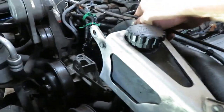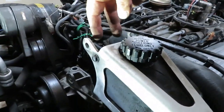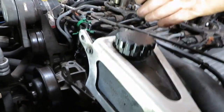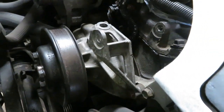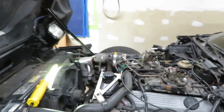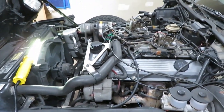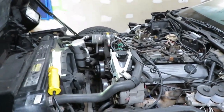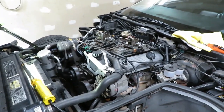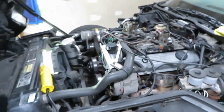I'm probably going to put the air pump back on without the pulley because this is a little flimsy — it moves a little, I don't like that. By rights I could probably put a piece of tubing in between here with a bolt, run a fabricated piece of metal from here to here, but I'm just not going to do that right now. I only plan on driving it like this through at least the winter all stock, and then maybe next summer maybe a set of heads, a cam, convert it to a carburetor. It's actually nice to drive just the way it is. We'll revisit this serpentine belt setup at a later date. I'm just going to throw that air pump back on with no pulley just to reinforce this bracket, then throw the belt on and see if it fits.